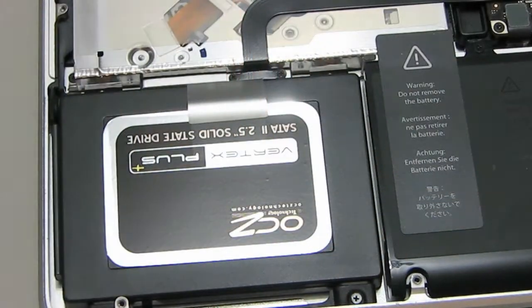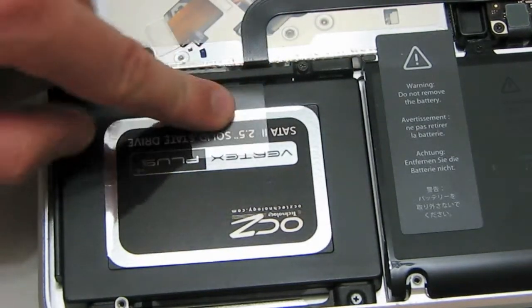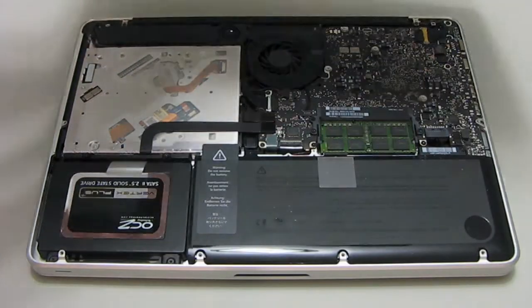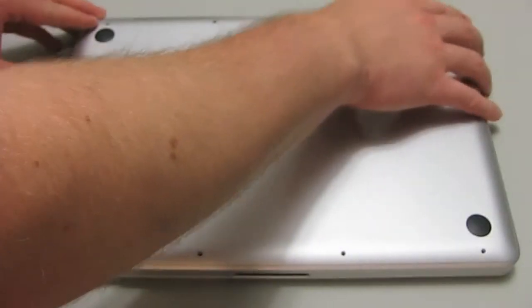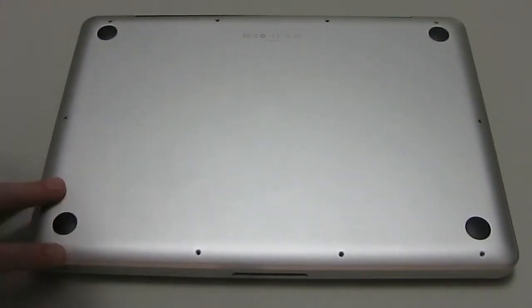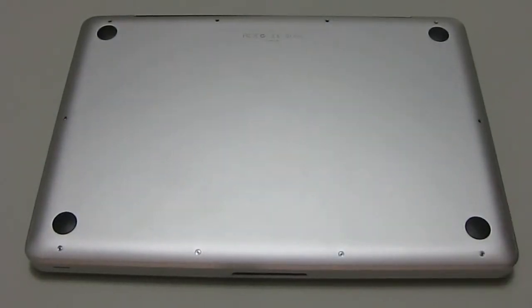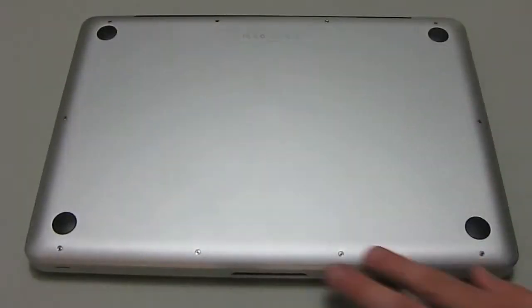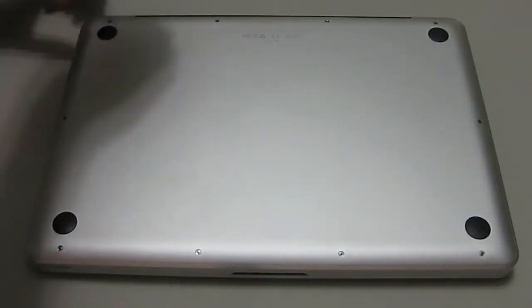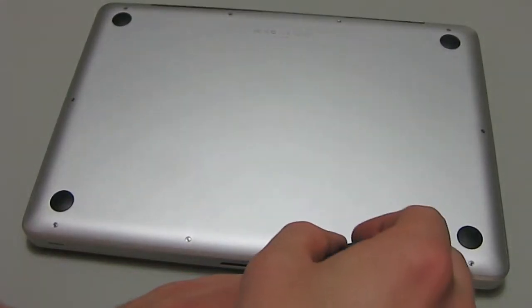Reattach the top mounting bracket so it will hold the drive securely in place. We are now ready to put the back cover on. Place the back cover onto the laptop and then put all the screws back in place. Be sure to be careful when tightening the screws as it is extremely easy to strip them. I usually tighten them until they are snug and then run my fingers over the screw to ensure that it is flush with the back cover.